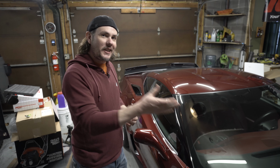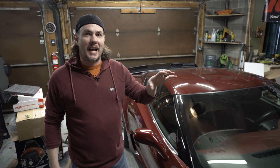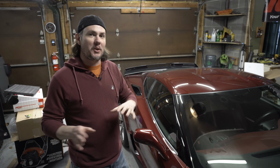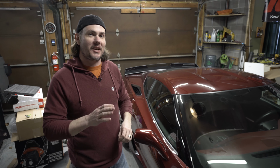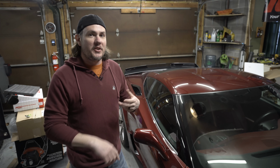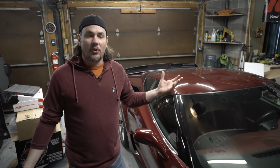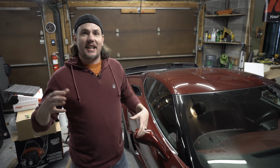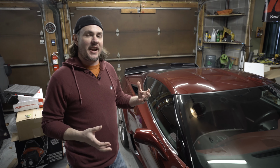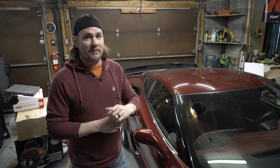Last but not least, don't forget to top off your oil, refill it back in. Since you've unhooked those lines, or if you had to unhook those lines, the last thing you want to do is forget small maintenance items like that. But whenever it's all said and done, you've got new long tube headers, new spark plugs, and a new oil change on here. Throw the thing back down on the ground, fire it up, get it out of the garage quick because it's going to smell bad for a little while as you're burning in this new stainless steel, and then go out and have some fun.